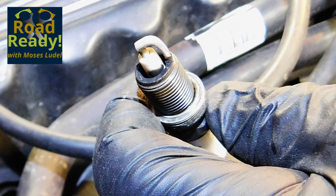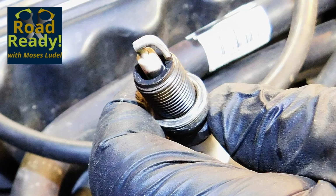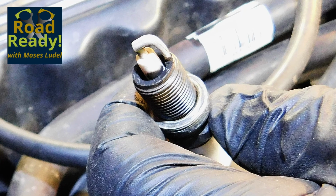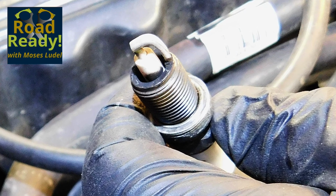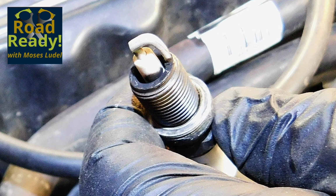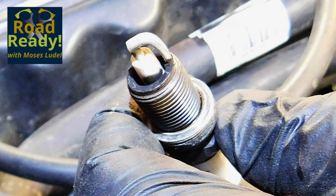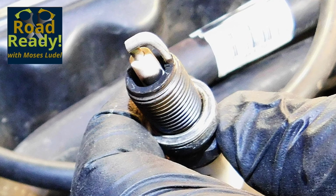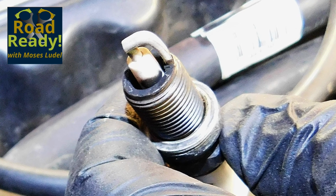We will concentrate on seeing that the engine runs as cool as possible, meaning a new thermostat, water pump, and so on, and also start adding Sea Foam as a gasoline supplement for the additive package. We saw excellent results in episode 2 when we cleaned the upper cylinders with Sea Foam using the SUR&R equipment. We'll continue to do that a few times to clean the upper cylinders.